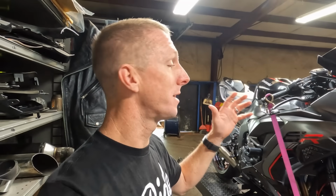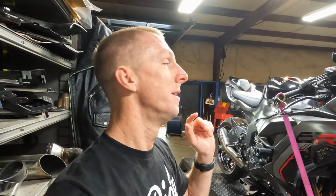Now, pair valve block off plates do not add horsepower. They do make the bike run cleaner, smoother, down low, if the bike is tuned for those. Then he wants to act a little hooligan on the street. He has his separate ECU, which has the same part number. There are stickers on the ECU that have part numbers. You gotta match up those part numbers. You can't just swap any ECU into any bike. The part numbers have to match on the ECU.